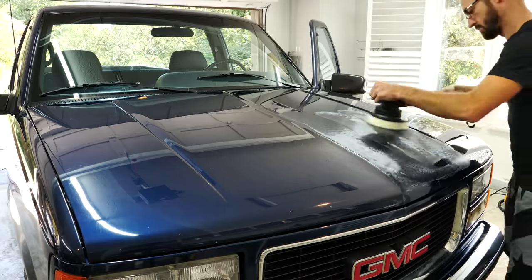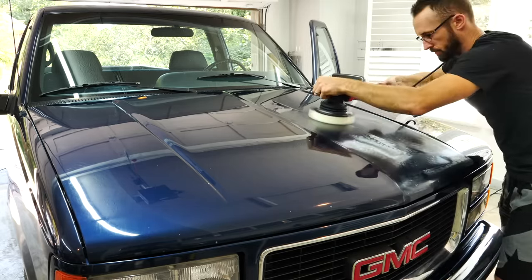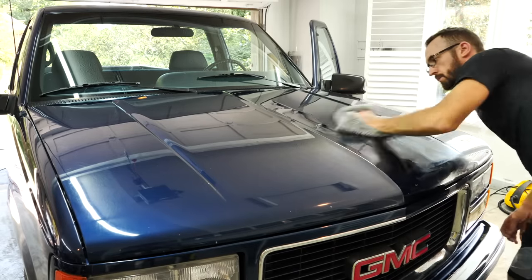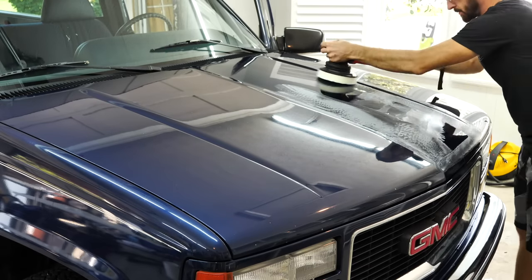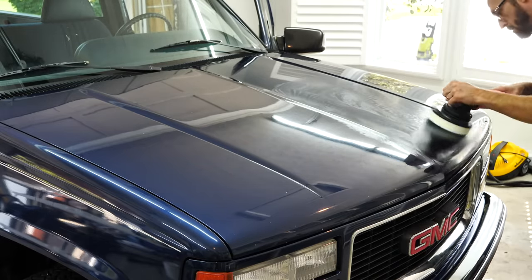Polishing technique is a whole separate video — let me know in the comments if you want to see that. If you use a random orbital polisher, it makes it really easy and almost foolproof to not burn through your clear coat and cause any damage. It really helps beginners learning and even pros, especially with the larger throw ones and the different compounds available. In these shots, you can see on the left is nothing done to the paint and on the right is just a single pass with the orbital polisher with the VSS. The second pass is obviously going to increase the clarity even more and get us about 95% of the way there.